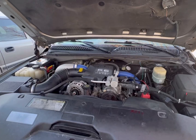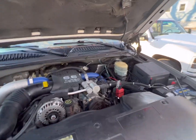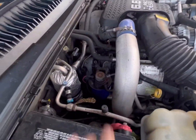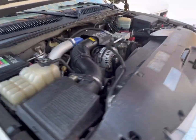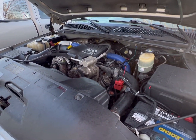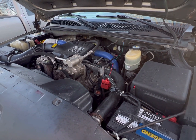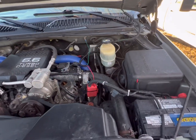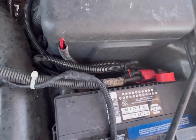Here's the underhood of Beater Max. Once you get your FAST in and plugged in, what you're going to want to do is actually open the fuel bleeder. I went ahead and used the primer bulb here and primed the system before starting the engine — it helps get some of the air out of the line. Then you leave that loose for about 15 seconds while the FAST runs; it'll push the rest of the air out. It cleans up, runs fine, everything is good — fuel system is good to go.